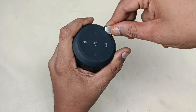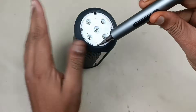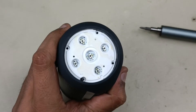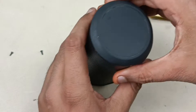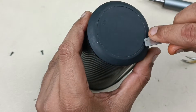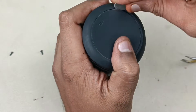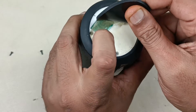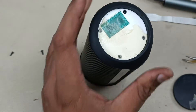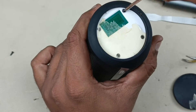Just follow the steps on how I am tearing this down. There are four screws here. Now the other side — while removing this, here the NFC board is there, a very thin board. Remove very carefully; just follow how I remove this flap. You can see here the board is here; we have to remove that carefully, otherwise this NFC board will break.